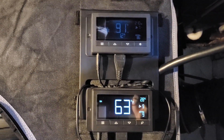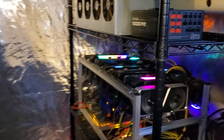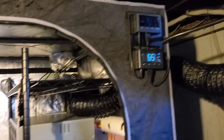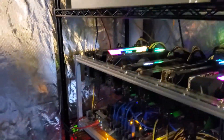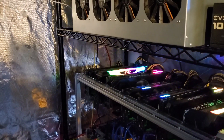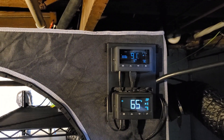I'm going to try to replicate these numbers so that when we check the before and after temps, it's as close a representation to the same conditions as possible. This card is always at about 47 to 48 degrees on the core temp and always somewhere between 108 and 110 on the memory temp. We'll try to get these numbers to replicate on the way out.